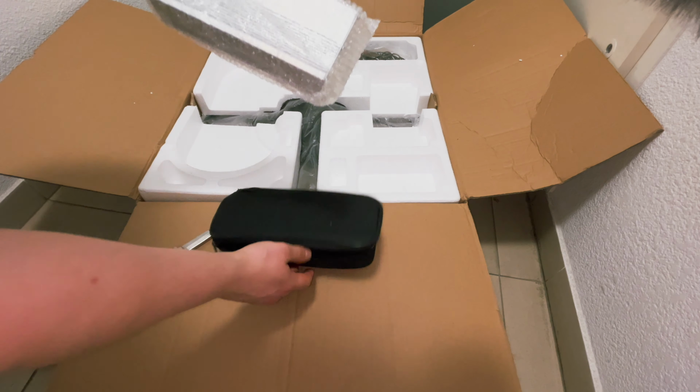You don't have to connect all cables. For example, I decided not to use braking sensors and leg pressure sensors. As I am only using the throttle to control my acceleration, I just don't use all connectors and sensors. The key installation is the motor and the battery, and the screen of course. All the other components are optional.